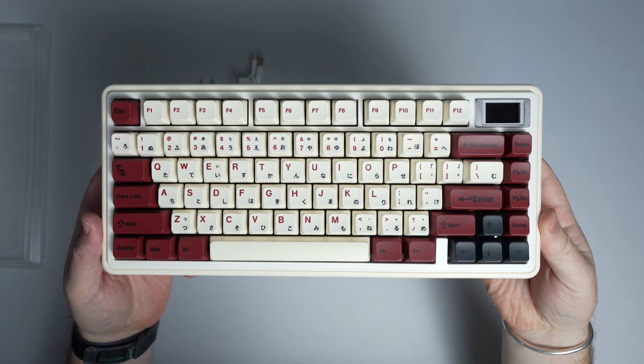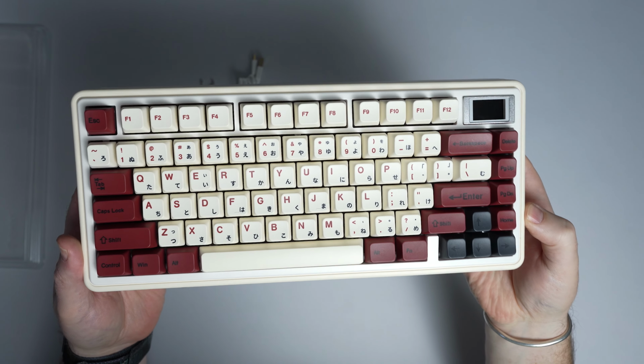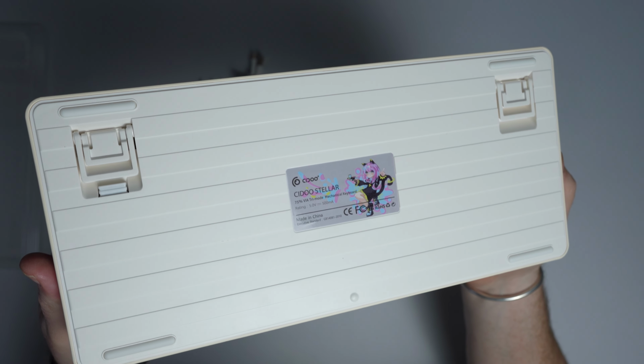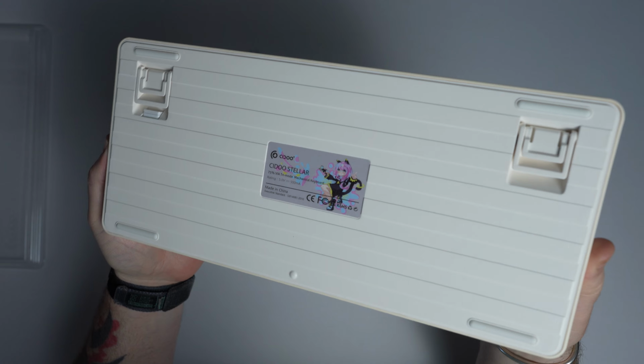While the anime branding is not my thing, I really don't mind the look of this one. Also, all the dampening in plastic budget keyboards these days gives them a bit of weight in the hand, which helps them feel a bit more substantial for me. The keycaps are MDA profiled dye sublimated PBT and passable for a fully assembled keyboard at this price point.